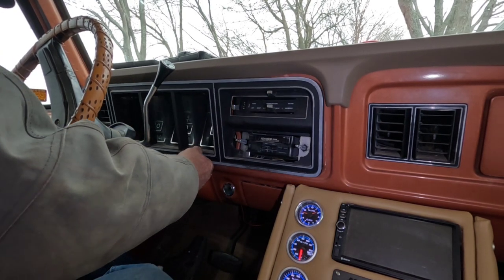That's going to finish up my video on my '77. One thing I may change is moving the tachometer light to a separate switch so it's not on all the time — it is pretty bright when you're driving and I don't really want that much white light in the cab at night. Sometimes I'll drive it on Friday night and coming home that's awfully bright in my face. Regardless, I like the way the LED bulbs look — really good. I appreciate you watching, always love those thumbs up and likes, love all my subscribers, feel free to let your friends know about my channel, and stay tuned for what else you'll see on 'What's Broke Today.' Thank you.